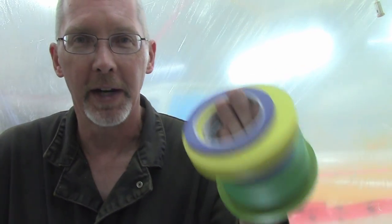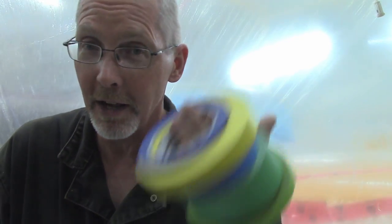I take back my enthusiasm for masking vehicles — this wasn't a whole lot of fun. I've got a bunch of tapes here. I find I tend to use 3M tape the most, although I'm always disappointed at the most inopportune times. You're going to want a bunch of different thicknesses — I use this little eighth inch, three quarter, one inch, inch and a half, and three eighths. Probably could use a quarter inch in there as well. Different thicknesses make it around corners a little bit easier. You'll find the tape sticks to everything but what you want it to — it'll stick to your gloves, it'll stick to itself on the roll and you can't peel it off, and then it won't stick to the vehicle.